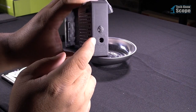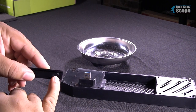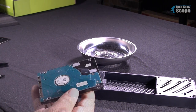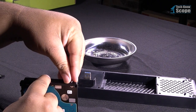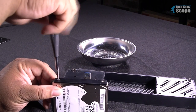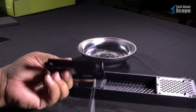This connection is for an optional 5-volt adapter. It's not necessary to run the device, but if you want plenty of power out of the front USB ports, you may want to consider buying one. If you take a look at these brackets, on one side they have recessed holes, which gives you an idea of which side the screws should go on. Take the plastic brackets and mount them to the hard drive using the provided screws. You want the screws to be snug but do not over-tighten them — they're not mission critical, they're only holding the brackets in place.